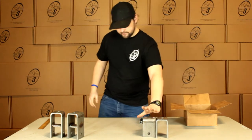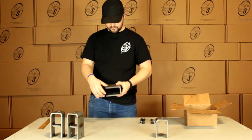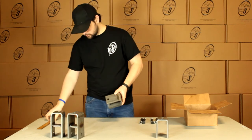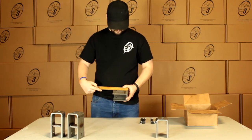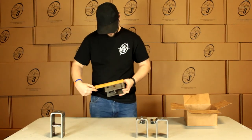What we're going to see here is this weld-on kit. The way we'll measure this is from your weld-on surface to the middle of your shackle bolt hole. This one's going to be 3 and 3 quarters. Then our rears are going to be 5.